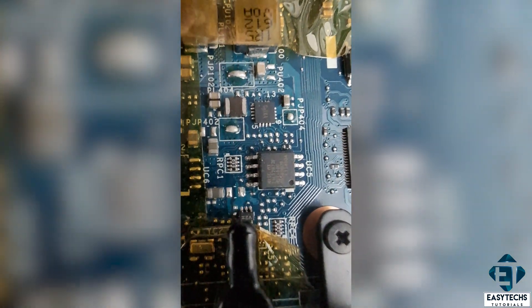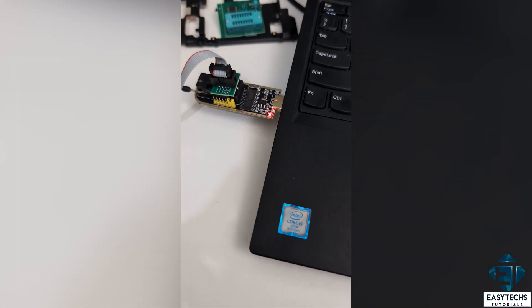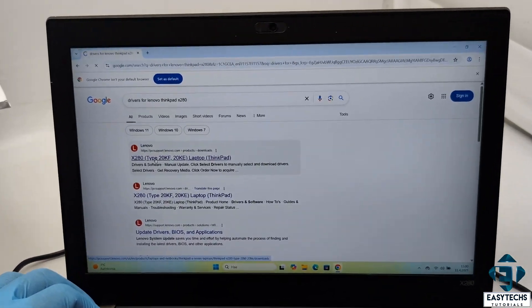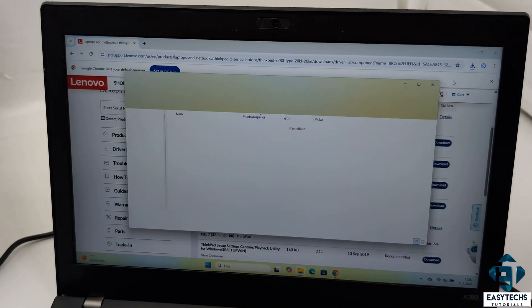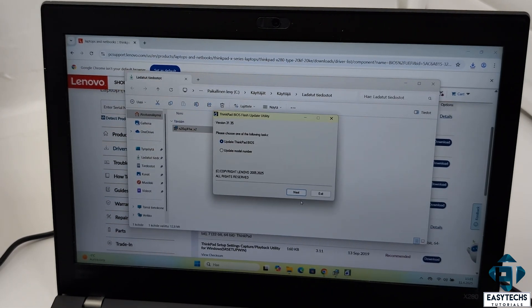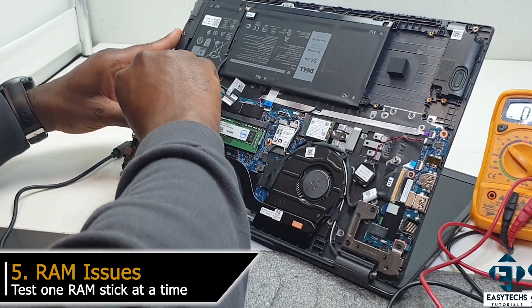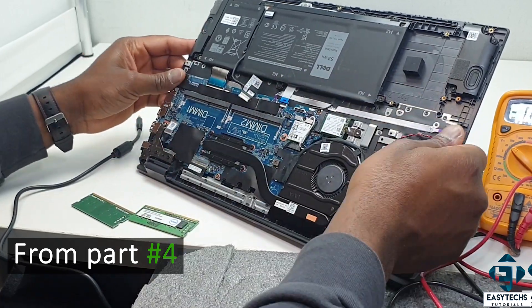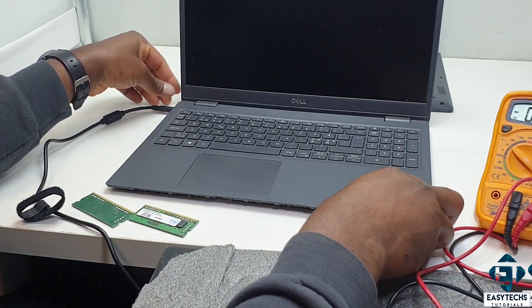Now, if your laptop doesn't show any signs of life and you still want to try updating the BIOS, then there's a separate set of tools required for that — I'll get into that in a future video. Here I'll visit the drivers page for this particular laptop model. You will need to visit your manufacturer's support page and download the latest BIOS drivers for your laptop, install accordingly, and try to see if that helps. In my case, that didn't help, so I'll proceed to the next step. The next step for laptops with removable RAM sticks would be to remove all RAM sticks and see if the laptop shows any new signs when you press the power button — maybe some beeps or some blinking LEDs — then put back the RAM sticks one at a time to see if a RAM stick is defective.